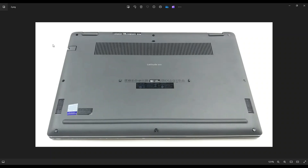Then you're going to take a small, flat, preferably plastic pry tool. I say plastic because they'll scratch your computer case a lot less than a metal pry tool will, but they're strong enough to take this bottom case off. Go around the outside seam of the bottom case and gently but firmly pry it up all the way around. Don't put the pry tool too far in — you can damage some internal components, just keep it on the edge. If you get stuck going in one direction and can't get it up, leave it alone, go to the other side and continue in the other direction.